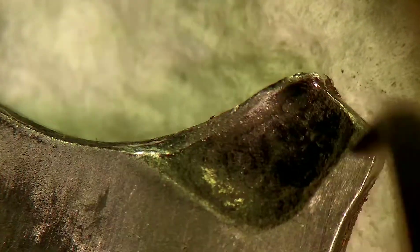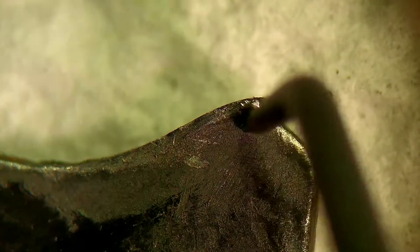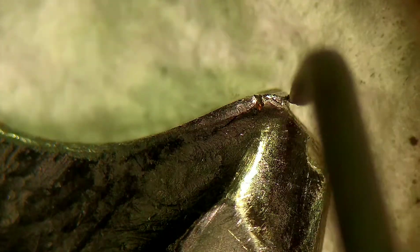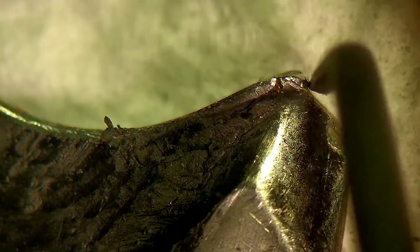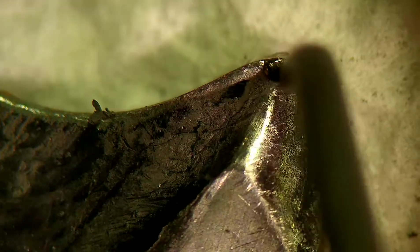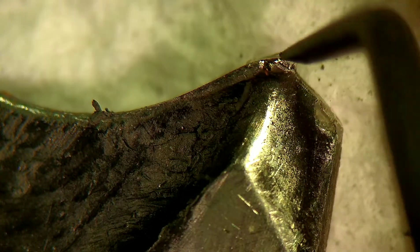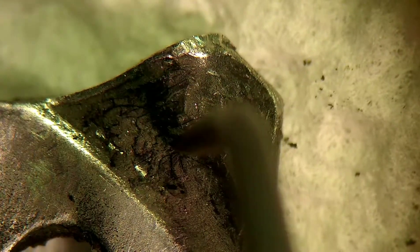There's a lot of power that gets transferred to these cogs, but they are made out of hardened steel, or so they claim — that's what MicroShift claims. I've never seen anything like this on any Shimano cogs, maybe some cheap ones, but I haven't run any of those. Look at this one right here — this is one with a ramp built in for shifting, and you can see where it actually starts to taper and it's kind of smooshed in. This is just under regular power from my legs, not an e-bike. It's the cogs that get used the most — the number 18 and number 15.